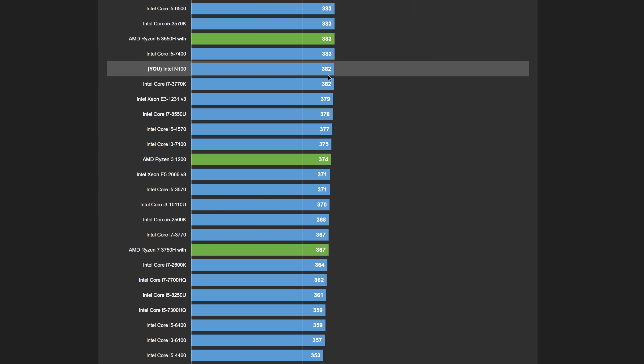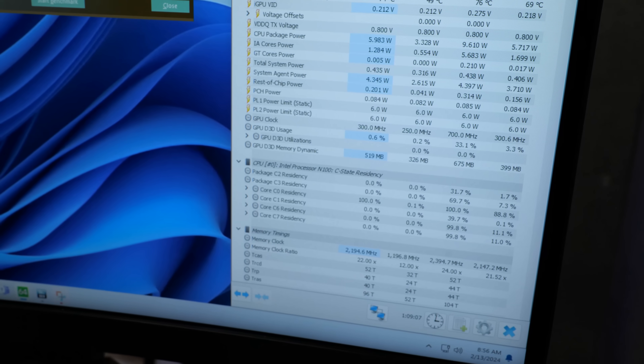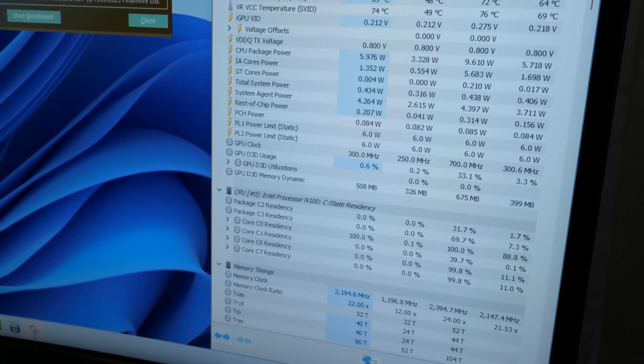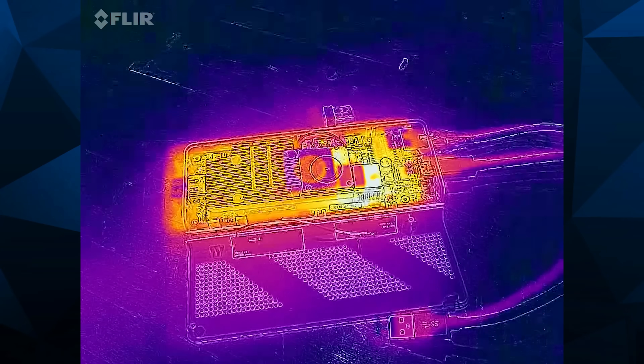This mini PC is struggling hard with its power over ethernet interface and doesn't perform the same as with its USB-C interface, at least when the system has been heavily loaded for more than an hour. If it's been sitting idle, the performance seems to be the same. If we check HWiNFO64 for signs of thermal throttling from a sensors perspective, we really don't see anything — but get out the thermal camera and around the power delivery area, it's like 85 degrees C. That's probably where the thermal throttling is coming from.